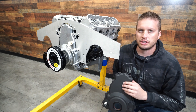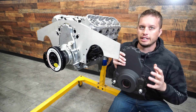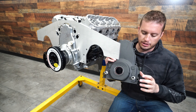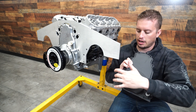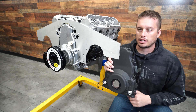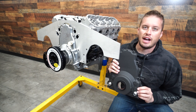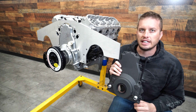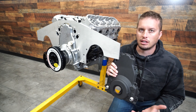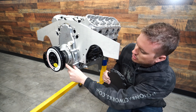Our simplest solution — we came out with this years ago — is a turbo oil drain timing cover. It's a basic factory-style LS timing cover. We have them in Gen 3 and Gen 4, and as you can see we weld a bung right in here on the very outer edge of the bottom of the cover. That way the oil can come in and go back to the pan, because it's all connected in the LS engine. This is an F-body balancer here — it's missing the AC out back, and it has tons of room for fittings.